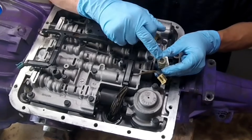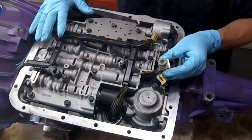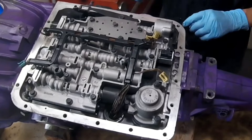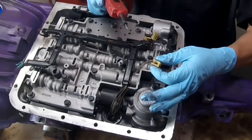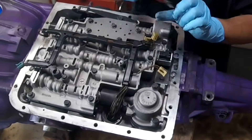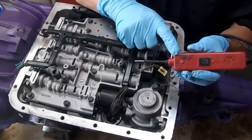At this point you want to check for gunk built up at your solenoid right here — that can let you know that you have other problems. Another thing to check at this time: if you have a power probe, here's mine — it checks continuity in the wire. You should have ground on both sides if your wire is good.